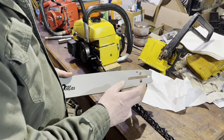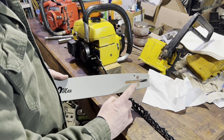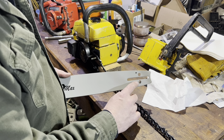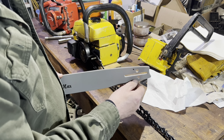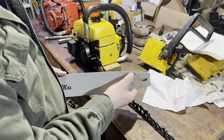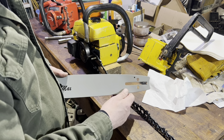This is the Husky small mount and it does not look like this — I did this with a round file. You have to open this up for the McCulloch's to get oil into your chain groove. What you need to do is throw this up in a vise, take your round file, and basically cut down away from the hole until you break through into the edge where the chain rides, and that's going to allow your oil to get into the bar. The easiest mount for the McCulloch is the Husky small mount.